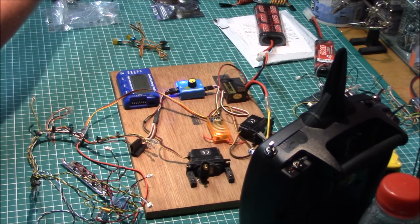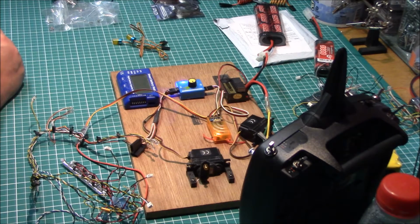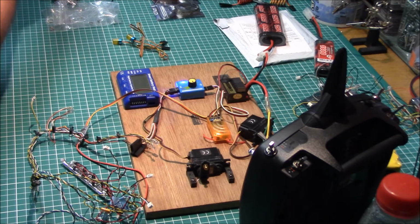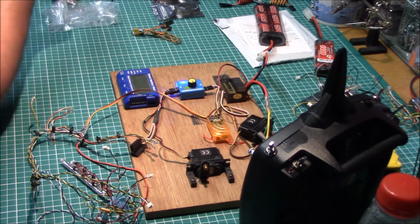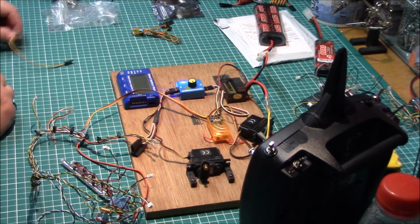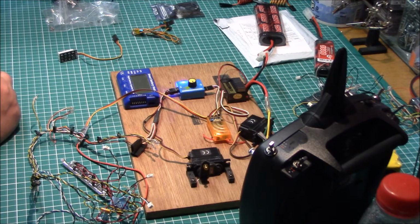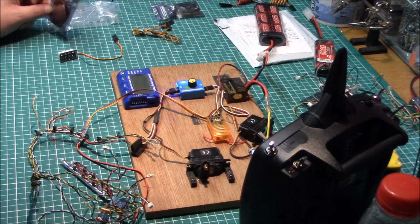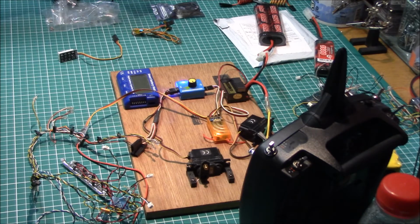It's got about 6 inches of lead to a servo plug, which plugs in your receiver, which powers it, obviously. And then you've got 10 sockets, which are all the same as a MFC. And then 2 servo sockets for, like I say, beacons or whatever, which are switchable. But all the other sockets ain't. And what I bought with it, because they always come in handy, is pre-wired MFC plugs. Oh yeah, they are handy. And they was quite cheap. I think they was only about £7 for 10. And rather than keep cutting and splicing and everything, you can just make your own up.